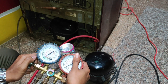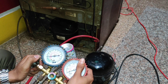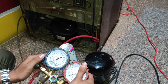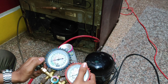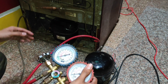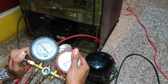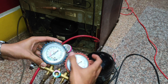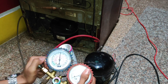Our gauge is still in vacuum pressure. We have to fill around 10 to 15 psi for our R134A refrigerant — we are charging around 10 to 15 psi according to our cooling process. For an R600A compressor we charge around 0 to 1 psi. Since ours is R134A, we are targeting 10 to 15 psi according to the cooling performance of the refrigerator. We have to give some more gas to this compressor.